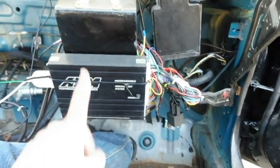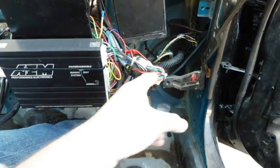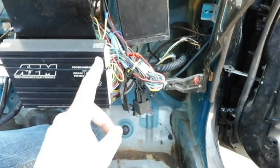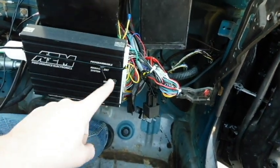That's why I went with the AEM Series 2 - you can build a complete crank trigger map from scratch. The good thing is, since I went with the A2 harness and this is still a standalone system based off the RSX-S, I'm able to use my A2 harness as plug and play. That makes it a whole lot easier versus building an entire harness from scratch using a completely universal system. So we've covered getting the engine in, the differences, and some of the wiring.